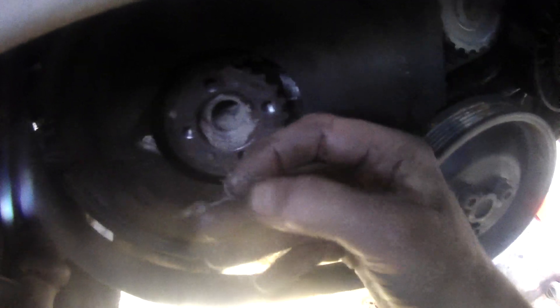I got that dampener stretch bolt out — that is the longest one I've ever made, it's so long. You can't use an impact gun on there because the bolt's too long. I should have taken the wheel off really, but that's laziness for you — done it by hand instead. Now I'm going to take off these Allen bolts and remove the vibration dampener. It came away from the timing cog quite easily, and you can see all this powdery stuff — that's all from that diamond coated washer which has broken down, it's so thin. I'll need to get another one of them and another stretch bolt, depending on what the engine's like.